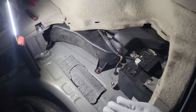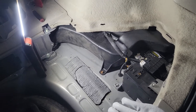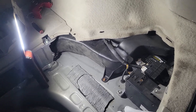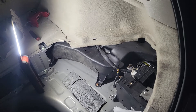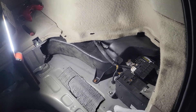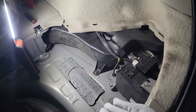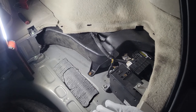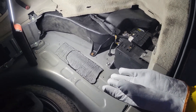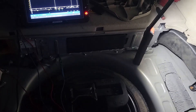I'm very careful and very slow about it because I've got my life to worry about — your car's not as important to me as getting home at the end of the day. That cost is added onto the customer because I'm not going to risk it, and I don't think the customer really wants that either. That's basically how you're going to be doing this isolation testing, but this is only for the high voltage battery.